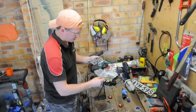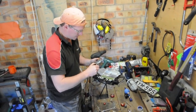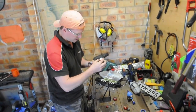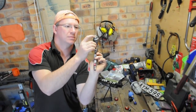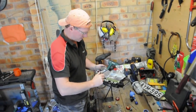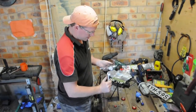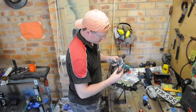The set that we're going to use for our colour and our colour and clear. Screw in the 1.8, the thicker diameter nozzle. On the nozzle itself, it should be written 1.8 on there, and it'll also have it on the front. But if you keep them together, it makes it a lot easier. You don't have to worry about any of that. Do that first before you do the other end. Then push that forward, spring goes in, put on your 1.8 head.